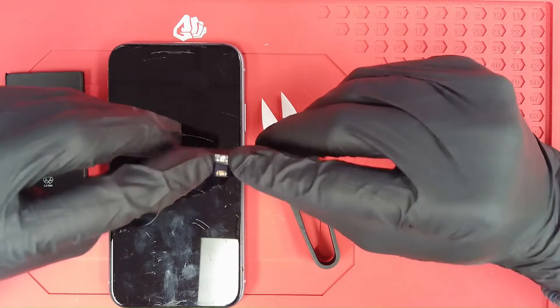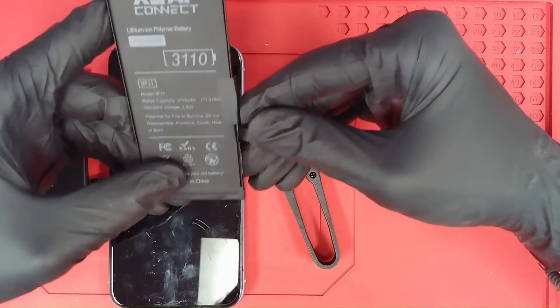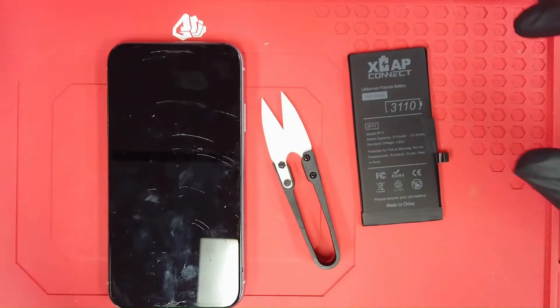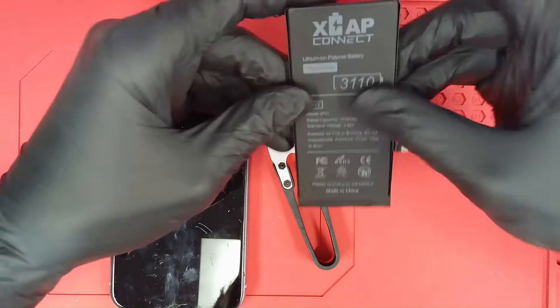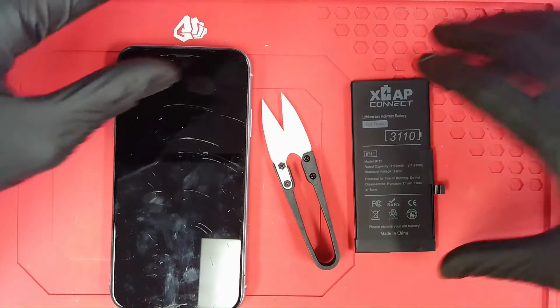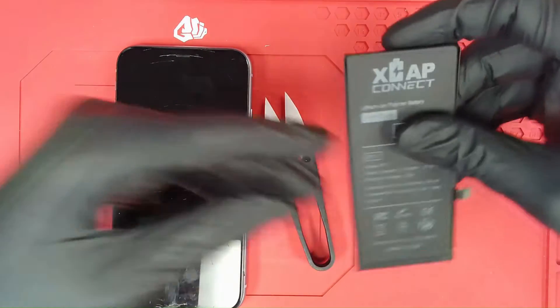With our design, with the FPC being in the original position, you can then lay and install the original BMS and the original flex will be designed to connect in the original position for the FPC. So with just a one snap install, we allow you to connect the original BMS and install it into the device. That is to prevent any non-genuine messages so we can retain the battery health management system, and this will also auto calibrate to 100% health because we'll have a brand new cell connected.